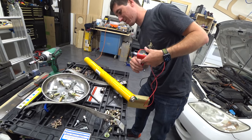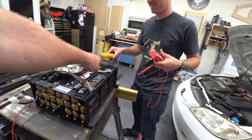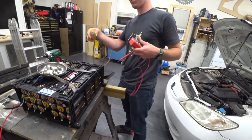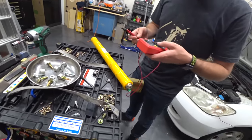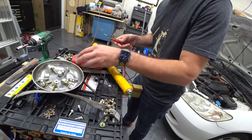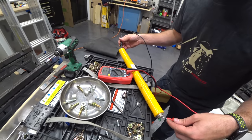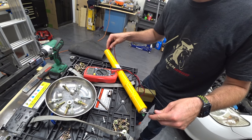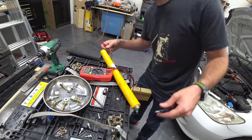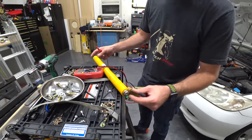I need to know which direction the cell goes — this ear's not bent, so the other one is probably bent flat. They do have to go in the exact same direction. We'll change this to 20 volts on the meter. We have negative 1.6 in this direction and positive 1.6 in the other. So the square terminal is positive and the hex is negative on each set of cells.